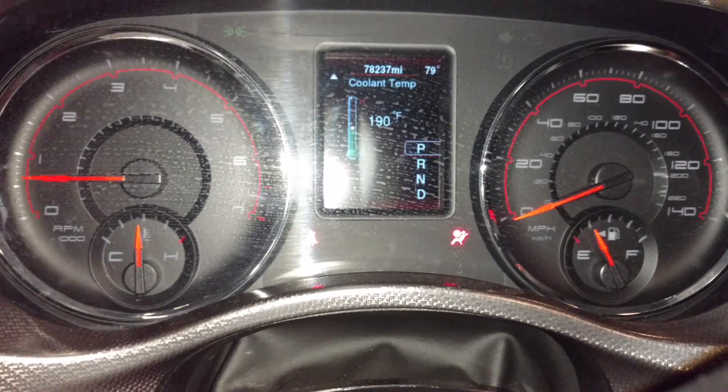Now you just want to keep an eye on it for any air bubbles coming out. I've got most of the air out of my system so we're not really seeing anything right now, but even if you're not, just let it run for a while — just in case there's something trapped deeper in the system. After it's been running for about ten minutes and you don't see any air, that should mean you got most of it out, so you're good to go.